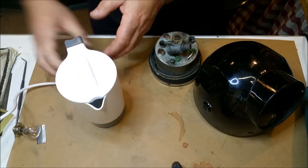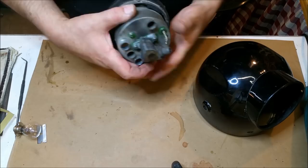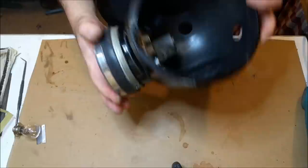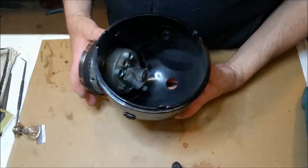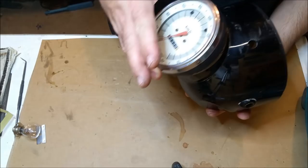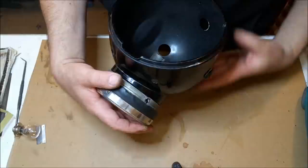Right, let's just move the Corjo for a moment. So when we pop this in, like that, the mounting hole's wrong, the OD of that's wrong, and the speedo drive is pointing into a blank piece of steel. So we're going to have to block this hole up, weld a patch in there, and cut another hole for that. I'm almost tempted to just do one big hole over here a bit, maybe block these two up, and then pop the speedo cable out through the back.